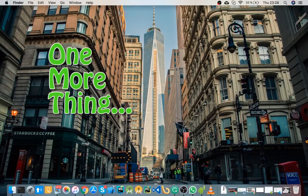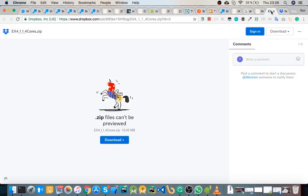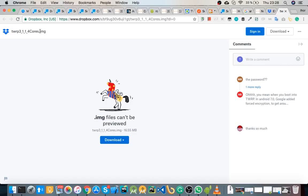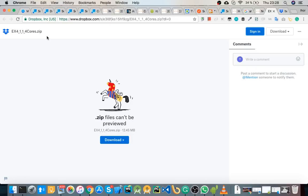Alright guys, now I got one more thing for you. There is a way to speed up your CPUs, even with those 4 CPUs that you've left. You can speed them up so that at least you get some performance. So first you need to download this image. It's a custom recovery. Then after you downloaded it, the link you can find in the description, open bootloader and run fastboot flash recovery and link to the .img file. You're gonna have a custom recovery, and also download this zip file. You're gonna need it later.